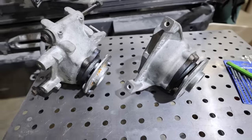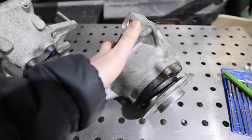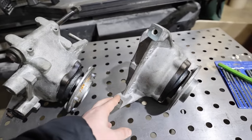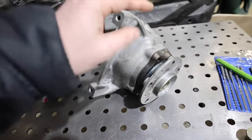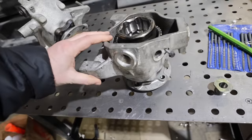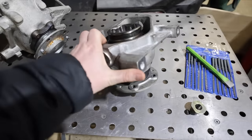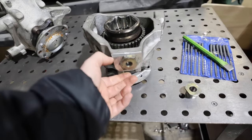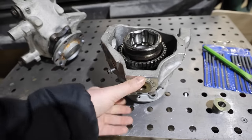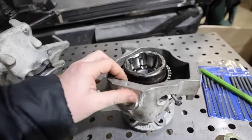The previous owner had purchased these brand new from Lamborghini. What we call these are knuckles — some people call them hubs. This one's the front and this one's the rear, and these big beefy bolting faces are where our calipers bolt to; rotors go on the faces of these. We also needed wheel bearings, purchased brand new. Anytime you have a massive wreck like that, you've got to get new wheel bearings or they will moan and groan until they finally stop working. We pressed our new wheel bearings in off camera — paid a hundred bucks and got both pressed. Now they are ready to rock and roll.